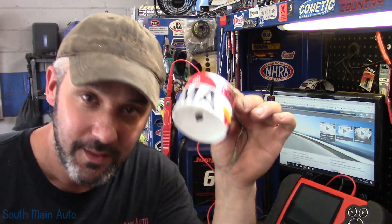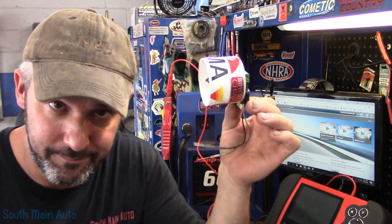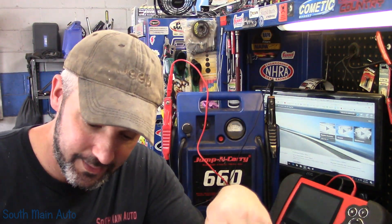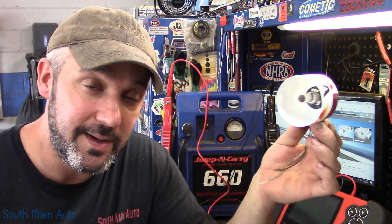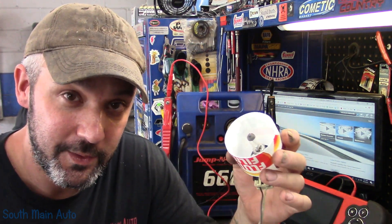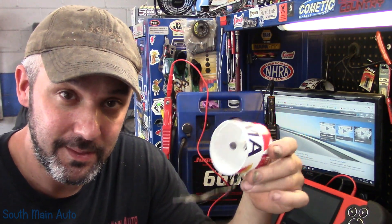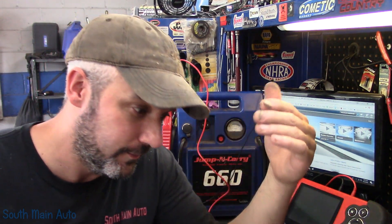Are they perfect in every situation? No. Are they helpful? Absolutely. And they're cheap and easy to build. We end up with a quarter amp, a half amp, a two amp, a four and a half amp — somewhere right in those ranges. Essentially, we end up with a fuel pump, a blower motor, a purge solenoid, a vent solenoid — all kinds of various substitutes we can use. You can use this to substitute a load that is missing, that is about the same amperage draw, on a safe circuit, and then do your voltage drop test, and make the call on the failed component. You know the component's bad already, but can that circuit carry the amount of current it's designed to run? These can help you along.